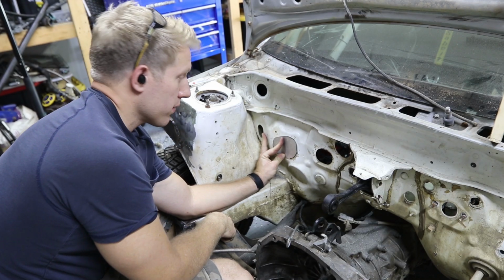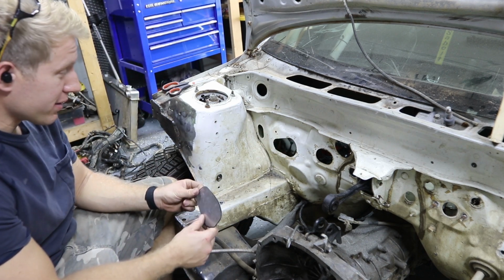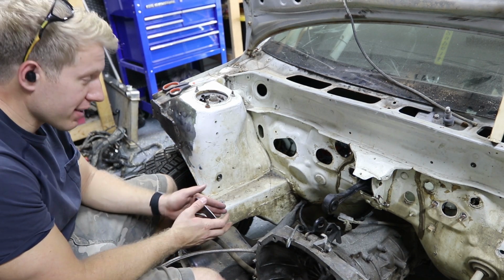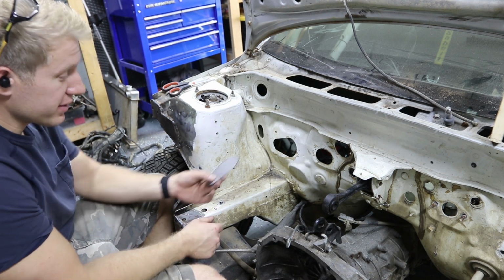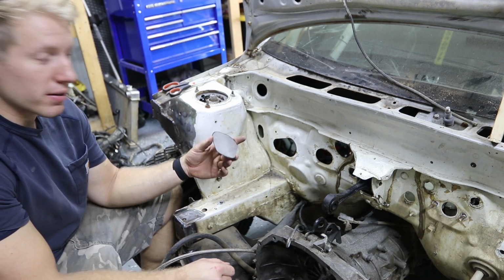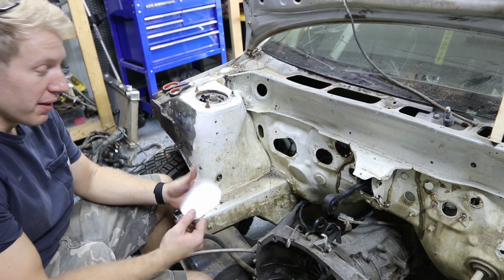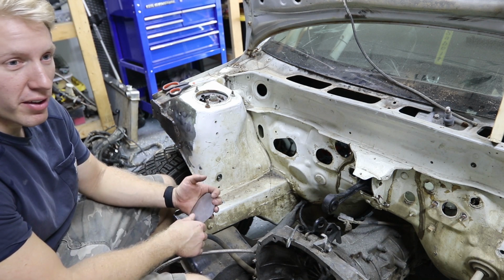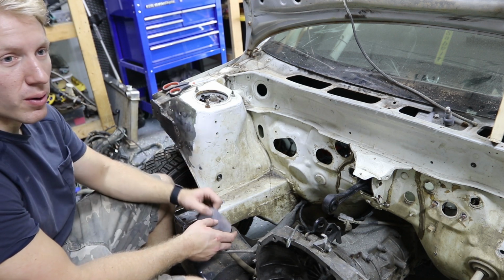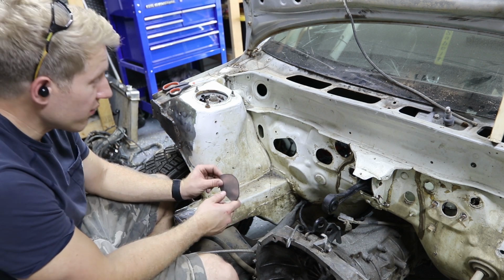Good enough for me. I love those tools, honestly. That bandsaw with the belt sander combo is my favorite thing that I've ever had. This is like the third time I've said that, but it makes it so much easier. A month ago, I would have cut this out with an angle grinder, even though I could have used tin snips because it's only 18 gauge. That's the type of stuff I was using to fabricate things when this literally took all of 3 minutes to make. Super nice. Definitely recommend. 10 out of 10.